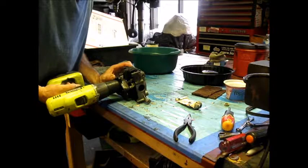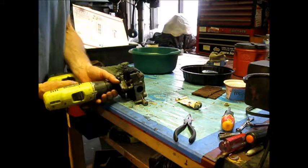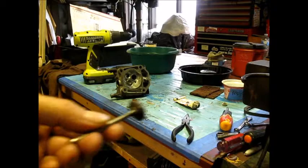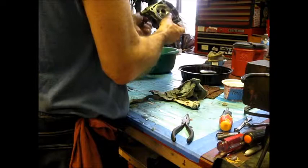I'm going to do this fast. Don't go too fast with the drill — you can hear it when it stops cutting. That should be enough; you don't want to cause any problems. Perfect. Look at that — perfect. Let's check the seat. Seat looks good. My light burned out of course — everything freaking breaks — but the seat looks really good.